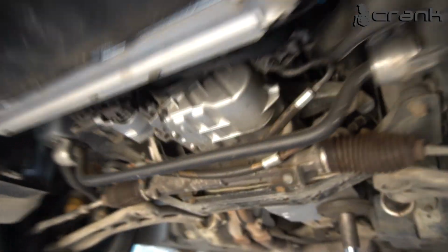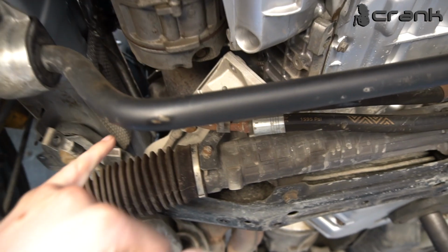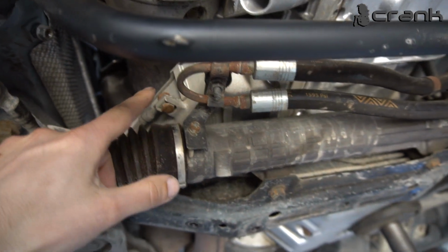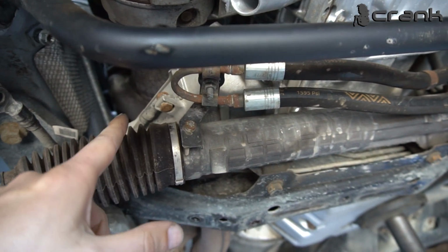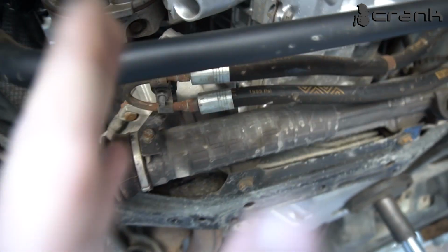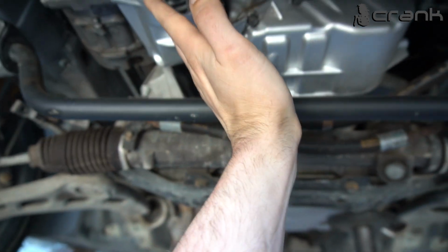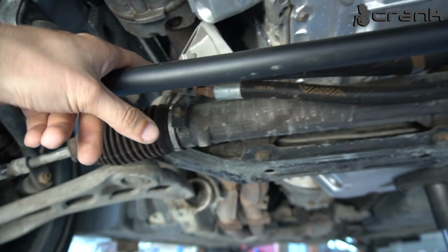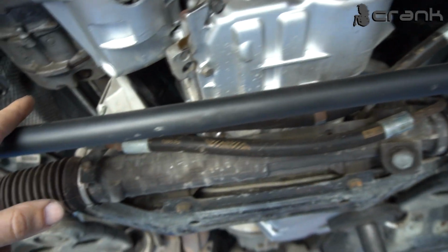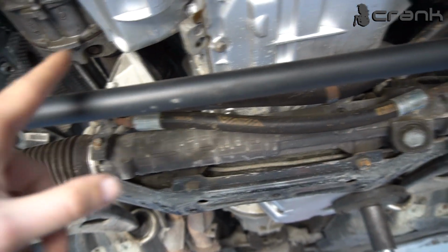the car, once again the right one is underneath the exhaust manifold, and we were thinking that the exhaust mounting is going to have much more load because the engine is angular and here it should have much more weight than on the left side. So let's see how much difference in wear there is between the two mountings.